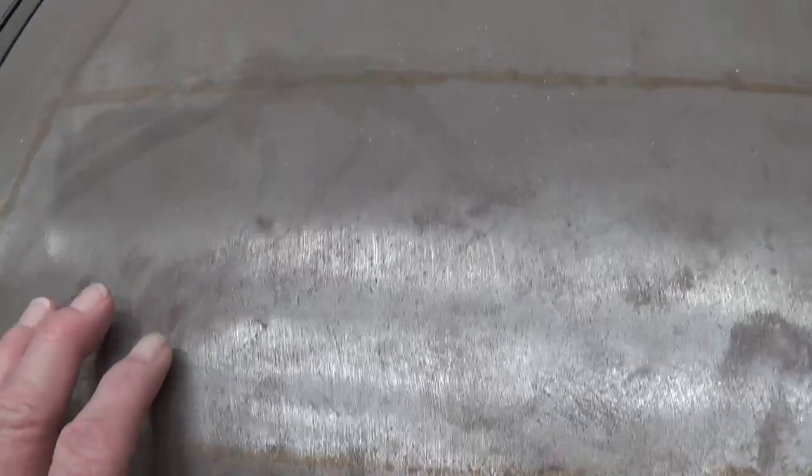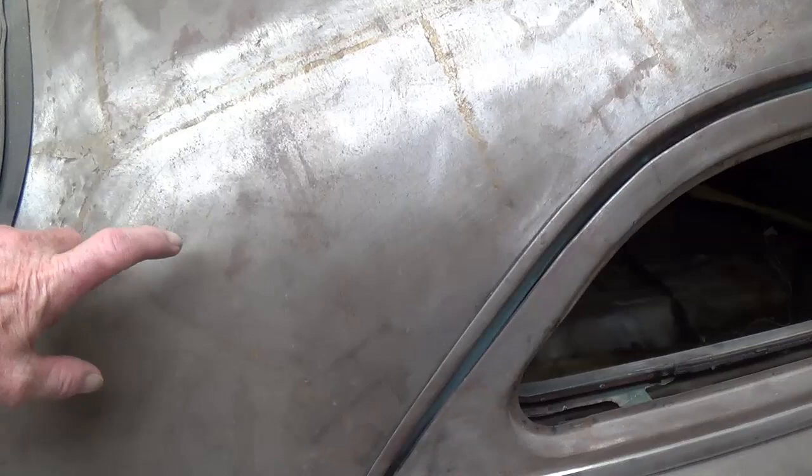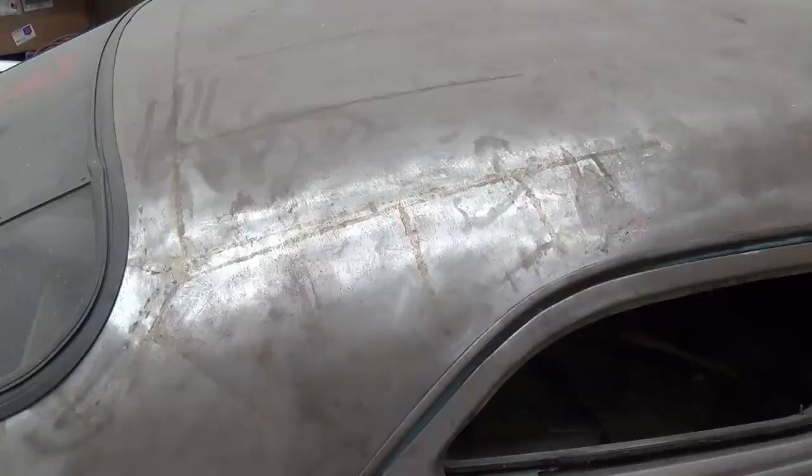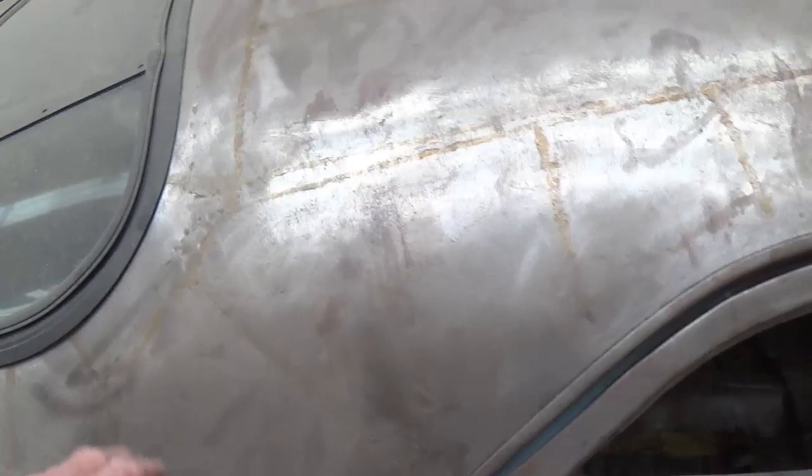Let's take a look at how this top was chopped — it's never easy. There are cuts that were taken out to bend the posts so they'd align. Sections have been removed, high cuts. Once it's got a skim coat and primer, all of that will vanish. It's like Frankenstein's forehead with all the incisions and sutures. It's a tremendous job — once you chop the top, the top doesn't line up with the bottom because pieces are missing. This slanted piece is gone so the top sits down and the lower posts are way behind it. It's really a major job to expand the top to fit where the lower cut-off posts are.